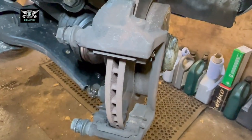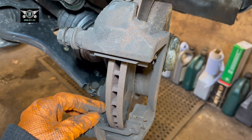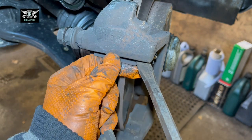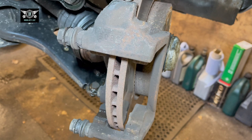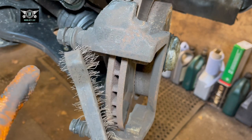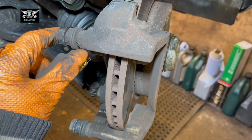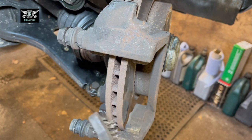We're going to remove these little pad carrier clips, clean them, and put them back. Sometimes you get new ones in the kit so you can just fit those. Before refitting, you can wire brush the area a little bit. When you're wire brushing, be careful — the wires can flick outward and pierce these little rubber boots here, so just be aware and take care when brushing.